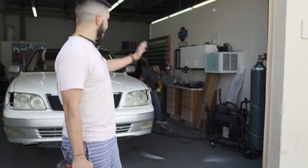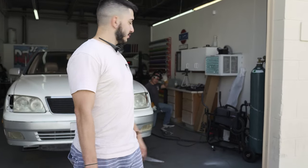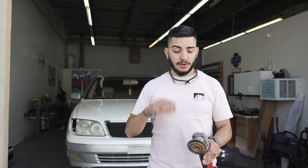So now that Casey and Ethan are here, and now my father, no, my father-in-law is here, we're gonna start working. What's up, y'all? I'm the boyfriend-in-law to him. All right, what we're gonna do now is I'm gonna take the flapper wheel. We're gonna actually get started on the Lexus. We're gonna take down the paint and the clear coat so once we get started on welding, we can get an actual clean bead and seal on it. For right now, we're gonna go ahead and use the flapper wheel on all four sides. And then we're gonna have Ethan taking progressive shots the whole time.